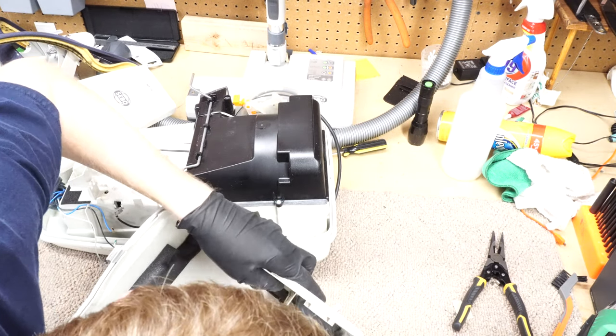Alright. So we got the motor, it's a Domel, 120 volt motor. I'm sure you guys overseas got something a little bit spicier. It's really clean. There's some carbon dust, but that's it. Carbons look like they have good life. We'll check those in a second. I'm gonna wash these pieces. The little rubber dinghies all in here. I'm gonna put those in the hand wash pile.